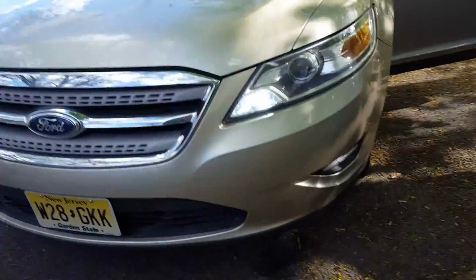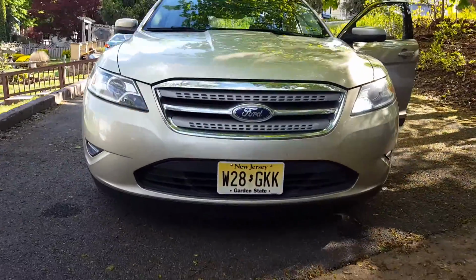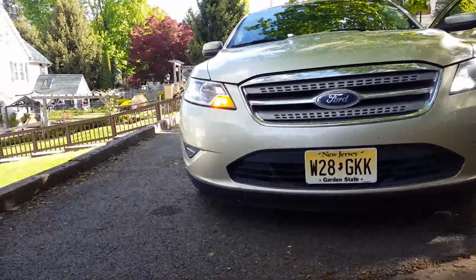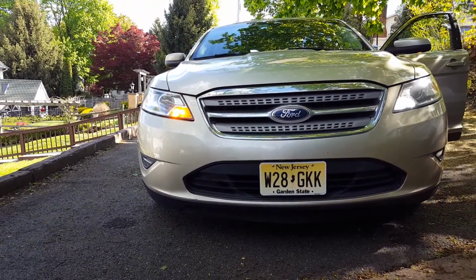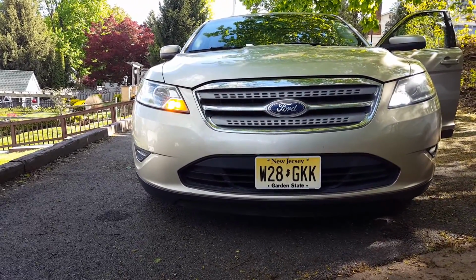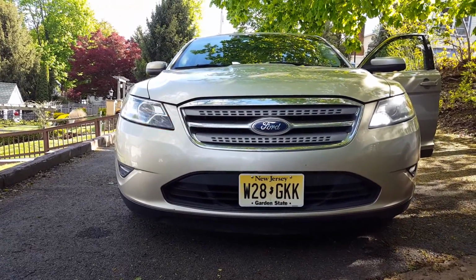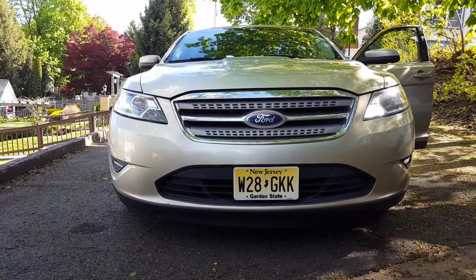So now they are back on. And over there you can see the comparison. As soon as the blinker is on, it turns off the white light as long as the blinker is on. You see the blinker is a little fast at the moment. I need to put in some resistors. I can put the information in the description. But that's pretty much it.